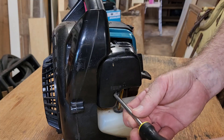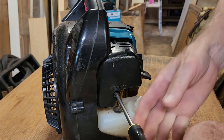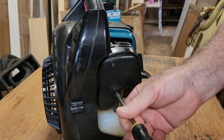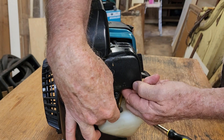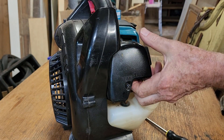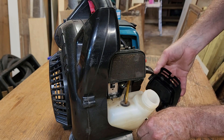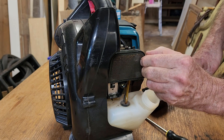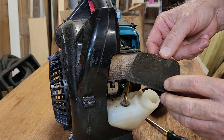I still don't think we'll need to pull the carby apart unless there's a problem. Let's take the air filter off and see what that's like — there's just one screw here to remove the air filter cover. Let's see how the previous owner was with his maintenance. The cover just pulls out at the bottom — it's got a couple of locating tabs at the top and it was a bit oily and greasy underneath.